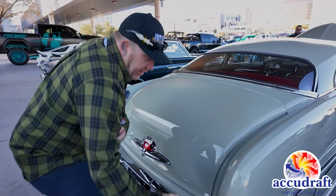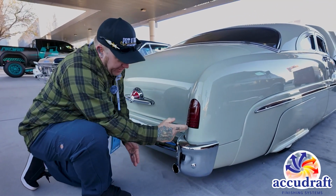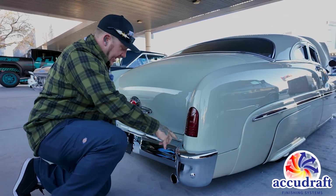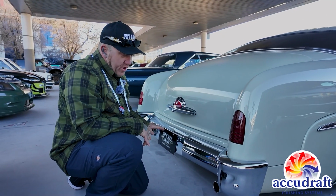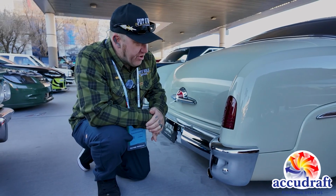The rear bumper, we actually cut it about 4 different ways. So we cut the width out of it so we get our peak back. We capped the end of it, brought it in nice and tight with the gap, narrowed it, and removed the overrider and all the hardware for the overrider. But we did decide to keep the bolts, again, a little bit more traditional.